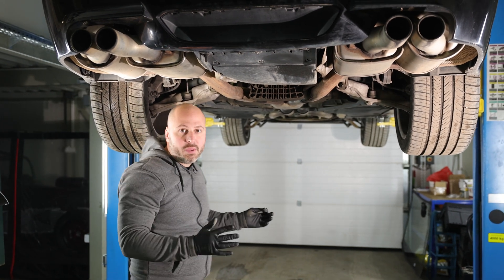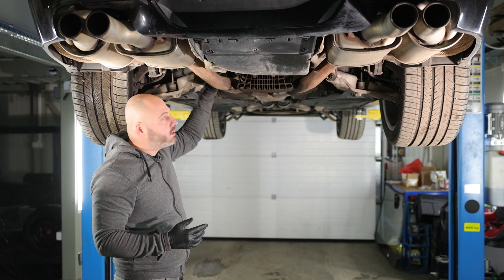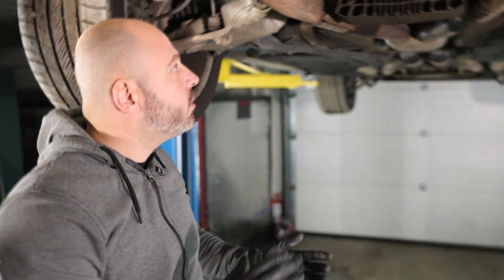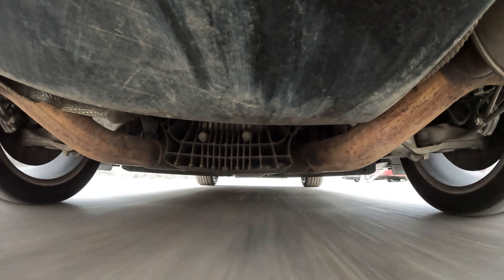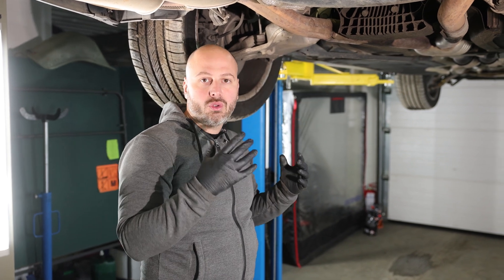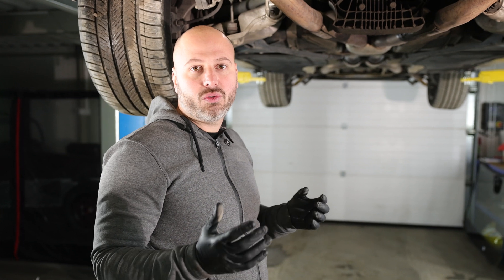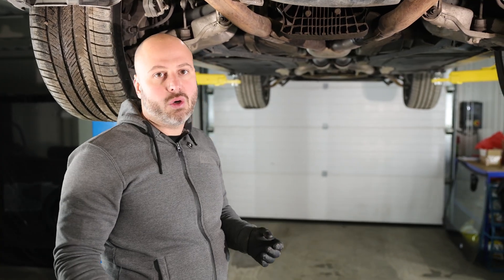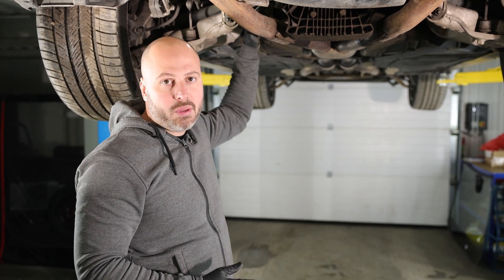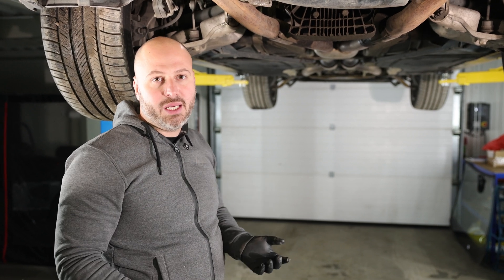This is the amount of free play. What is happening with that, and why is it a big problem? When this flange develops free play — both axial and radial — the oil seal in most cases gets destroyed, so you have an oil leak on this side. If you don't refill the oil, the differential will lose enough oil to start making whining noise from the bearings, and the bearings can eventually get destroyed from this problem.